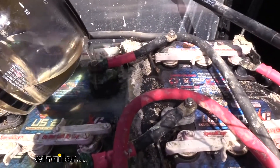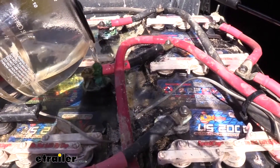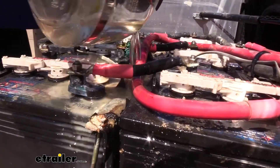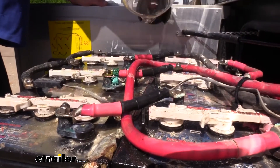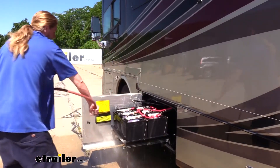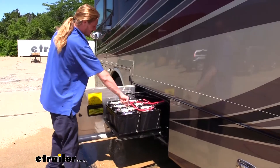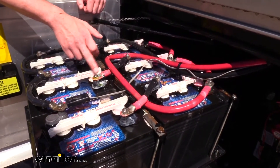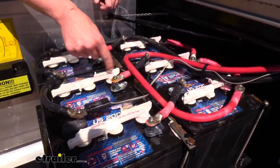We're just trying to get the bulk off first so we can get these nuts off and then clean them up further. The stuff just melts away under the warm water. For the stuff that's thick on the end of your cables, just take a cup, put some hot water in it, and when you take the cable off you can dip it in that cup and slosh it around — that'll really melt it away. You can see how much better it looks. You do want to take a hose to it afterwards because that hot water melts the corrosion off pretty well but it's going to run down and sit in your tray, so you want to wash it out so the corrosion doesn't spread any further.